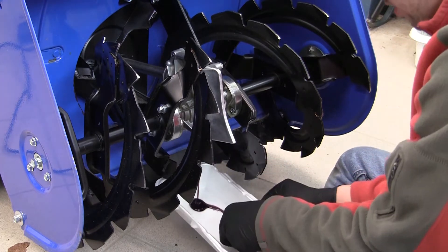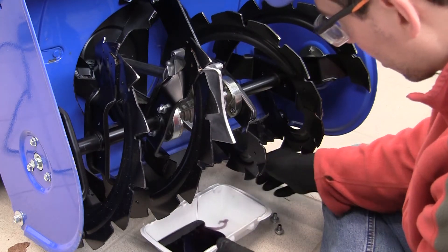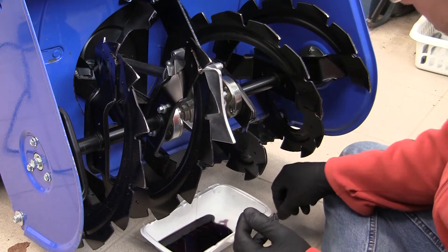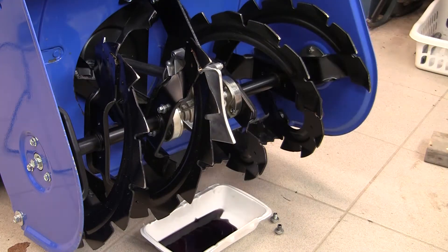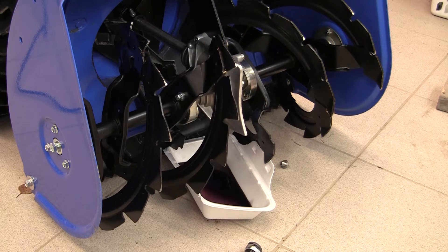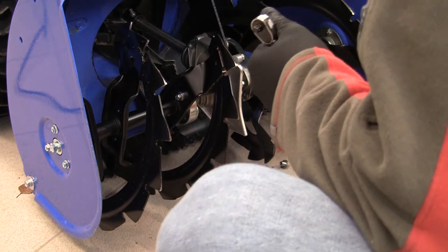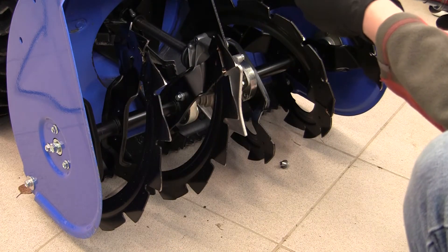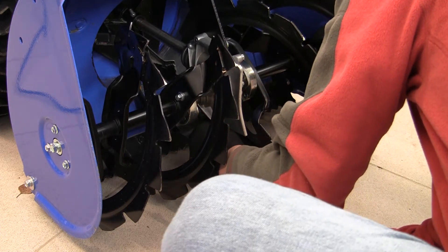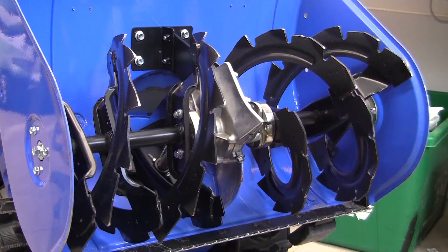There it comes out - that Royal Purple, and it's still purple. Now we're just going to tilt the snow blower back down but not do a rookie move where we catapult the container away and make a big mess. The torque spec on the worm gear bolt and plugs is 139 inch-pounds. I like to put drain plugs back in right away for the obvious reasons of not forgetting. We go underneath, torque that bolt to 139 inch-pounds - pretty high but that's the spec. We hit torque spec, wipe up the oil, and get ready to do the fill.